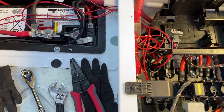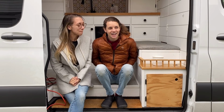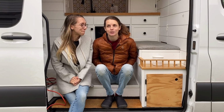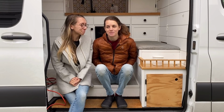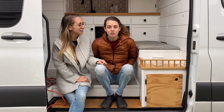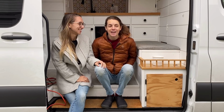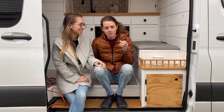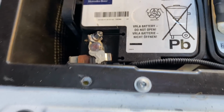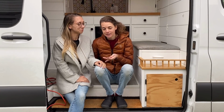just waiting on that 2-aught. Friends, we did have one little mishap this week. Yeah, I thought about filming it. I was in such a bad mood. I was so miserable for like a day and a half because, as you will have noted in the video, it's very important to take the negative battery terminal off of the starter battery before you remove the seat. Otherwise, you get an error when you put the seat back in.